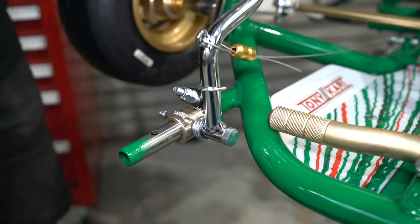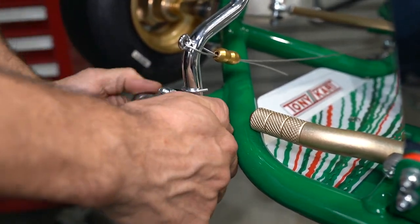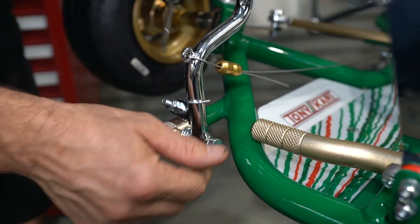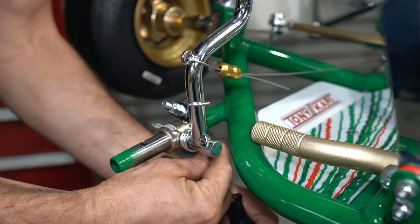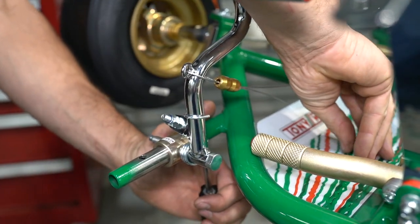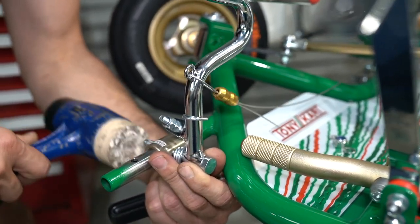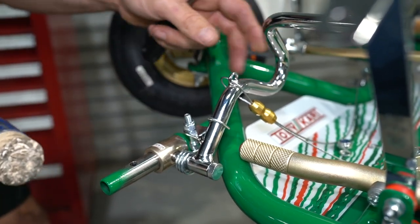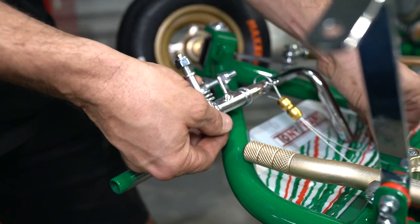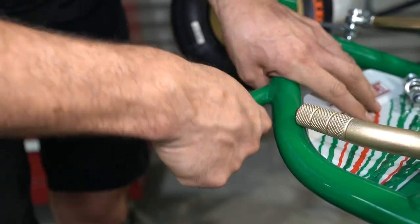And it's the same for the other side. If the spring is a little bit stuck you can just get yourself a flat blade screwdriver and just slowly wedge it out of the frame. And with a soft face hammer you can tap the pedal bolt back out of the chassis if it's a little bit stuck. Now we can remove these little brackets from the frame — we're not going to use them on the new kit.